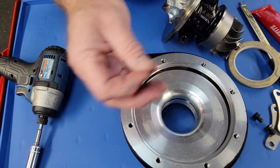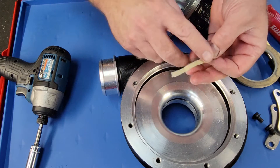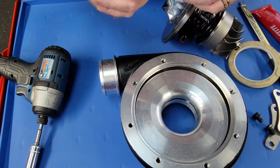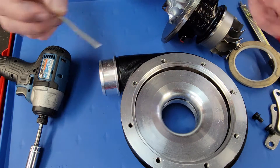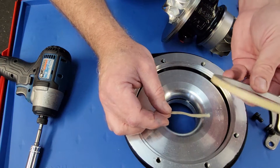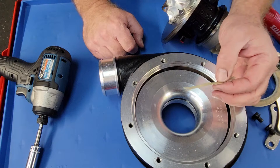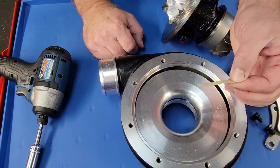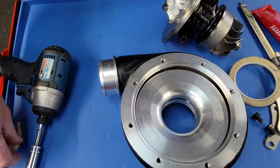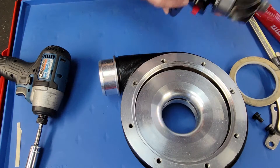With a new turbo, we check clearances this way as a really quick go or no-go to see if the turbo has the correct clearances. Is this a foolproof way of knowing if the turbo is good inside? No, it's not — but it's a good indicator. If when you put the third piece of tape on, the wheel just tries to rip the tape out of the housing, the turbo could be okay or not okay depending on how thick the tape is. This tape I use comes from a master car — it's been my standard for years and I know it's five and a half thousandths thick. So we have just under 17 thousandths clearance between the wheel and the housing at this point, and that's acceptable by my standards. Very simple, easy way to tell if you may have too much bearing clearance. You can also do the same on the exhaust side — exhaust sides are tricky because turbine housings, if they're used, are cast iron and will have some rust and soot, so clean them first. The clearance is the same on the turbine side as it is the compressor, though some turbos will have a little bit more on the exhaust side. If it gets to four pieces of tape before touching off, all hope is not lost — you're probably okay.